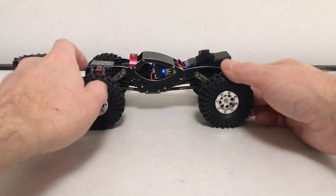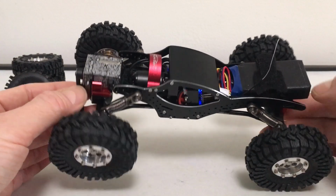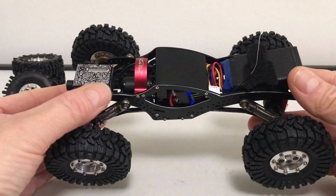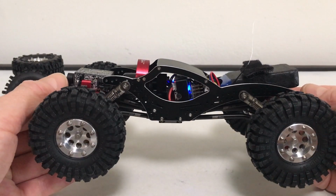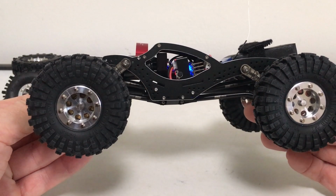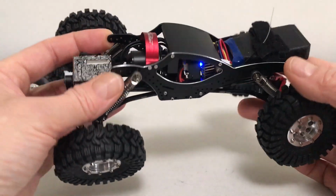The major hiccup was probably the weirdness of not being able to fit the forward-facing FURITEK KOMODO motor under that motor cover. So I don't know what the deal was there. I don't know if they made a design tweak from the V1 to the V2. I know the motor cover is different on these V2s, but having to swap to this MOFO RC BAM 1900 kV motor was not a bad solution at all. In fact, I am probably happier with this motor in here than I would have been with that giant Komodo.